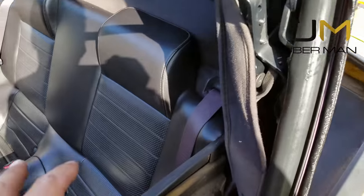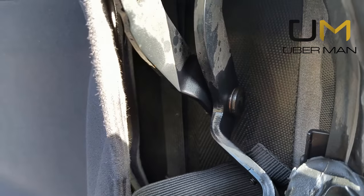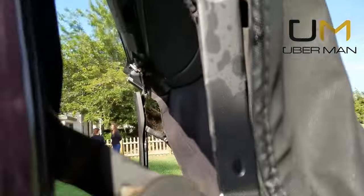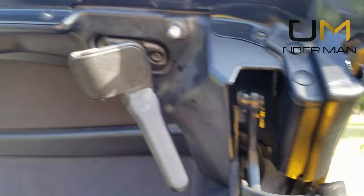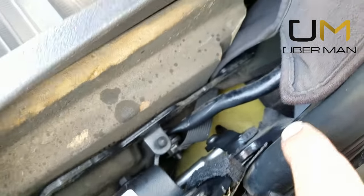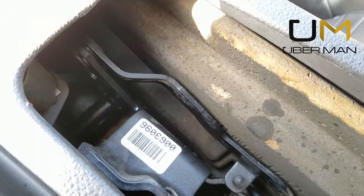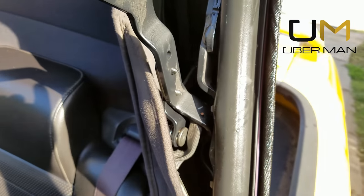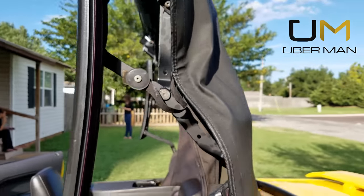If that's the case you're going to have to get in there — usually it's behind the seat, you pull the seat out and check and fill the hydraulic fluid. It's a good idea to drain it and refill it as well. As you can see back here, we've got a hinge here, a hinge back here, a hinge right here, and a hinge up here. All these parts move. There's even a hinge right there at the top. You can also see the drain hole for water draining right there — make sure it's nice and clean.